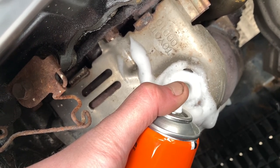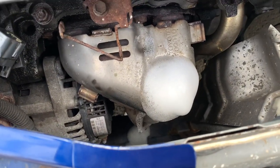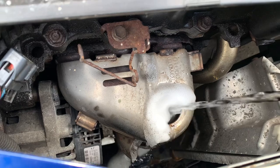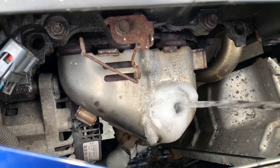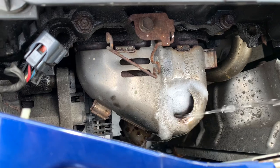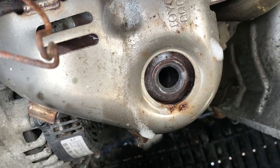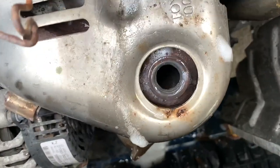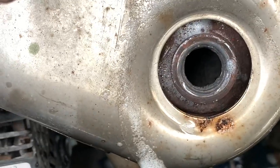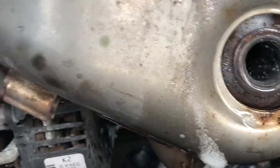Exciting stuff. Riveting viewing. And now I'm just going to leave it. Right, so as we can see that has been soaking for a while. As if it wasn't stupid enough to put oven cleaner in there, I'm now going to fill it with water and rinse it through. And hopefully it won't go in all cylinders and completely bend a rod and all that kind of shit. Probably will though. Anyway, let's rinse it through and see how it looks. It's quite hard to see but the water level inside the manifold from the catalyst isn't going down as fast as what I'd like. So I thought I might have taken the piss before saying it might go in the cylinders. If there's an exhaust valve open it's probably going to go in the cylinders, so I better be careful when trying to start it.